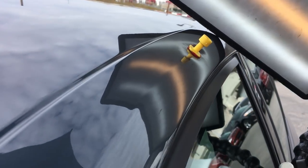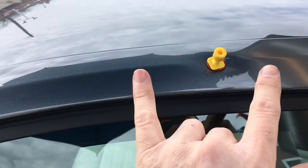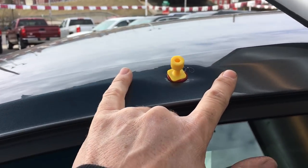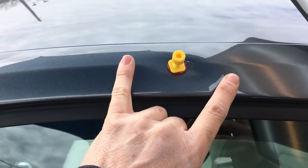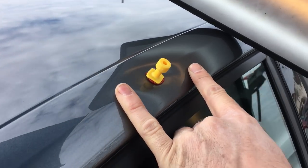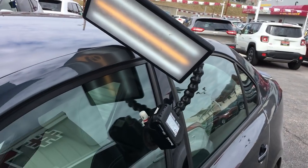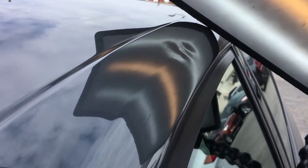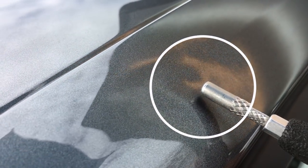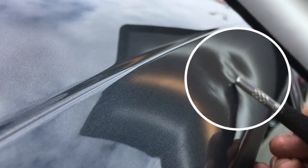Using a square tab, try to pull that center up. See how much area we have there — the metal flared out fairly wide now, from there to there. It's a lot bigger than what it originally was. I could probably spread it out even farther, but let's see how this does. That pull moved the center the way I wanted it to. The center is slowly getting smaller and smaller. Every time I pull it up, it's a lot smaller than what it was before.